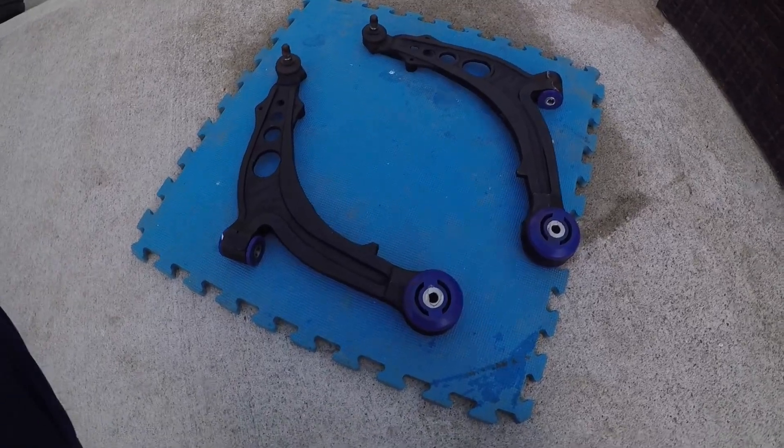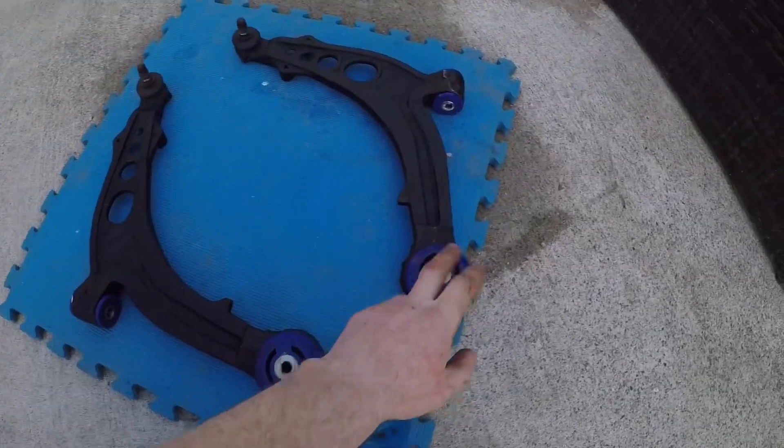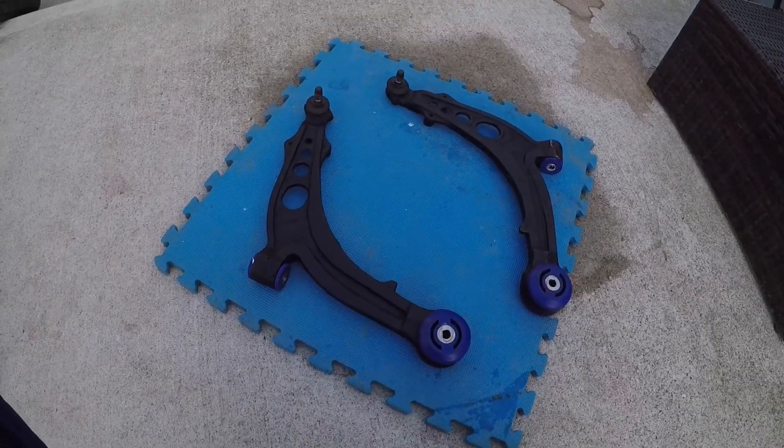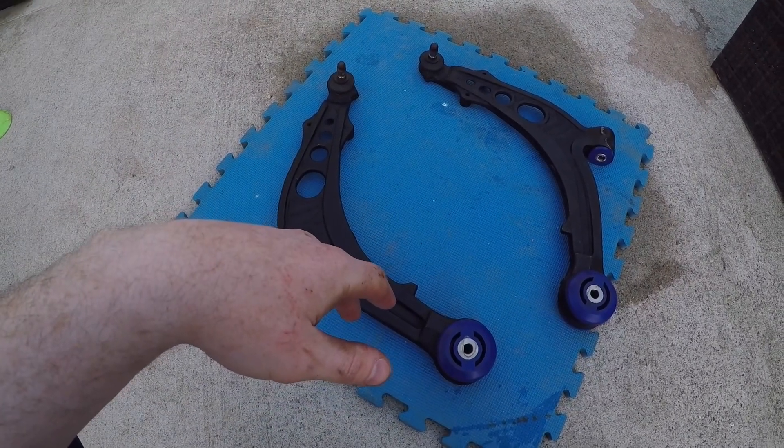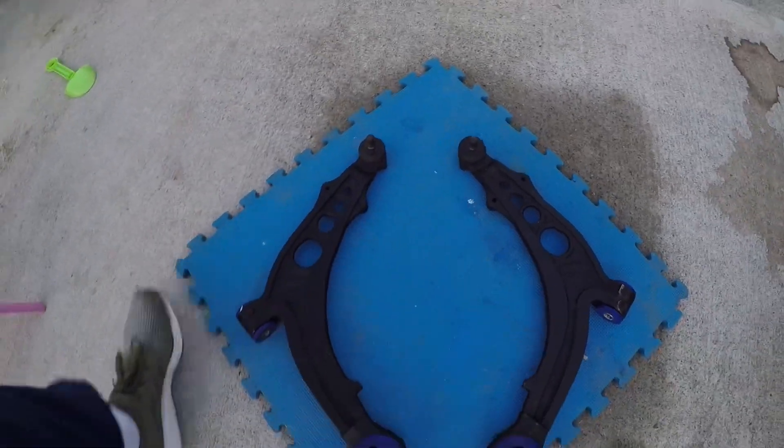And as if by magic, they are done - all bushes done. We've got all collars fitted, we've got PTFE tape on each steel cylinder to stop them squeaking. We've given the original wishbones a good wire brush down and a new lease of life with some underseal. The ball joints on each one are in good condition so they'll be going on the car in the next video. In the next video we're also going to be putting on new anti-roll bar bushes - there's four of them, one on each end and two in the middle - and we're putting on the OMP lower brace to help stiffen up the handling. The PowerFlex bits will all help that too. There's also a couple of scabby bits under the car I'll wire brush and clean up while these are off. If you like what you see please like and subscribe to help support the channel - see you in the next video, cheers.